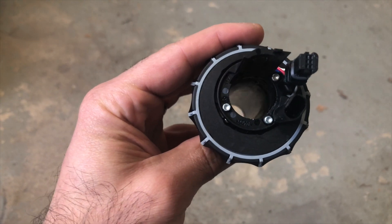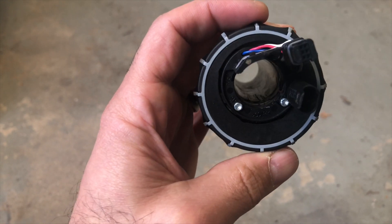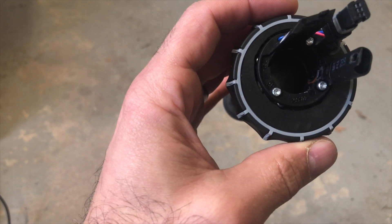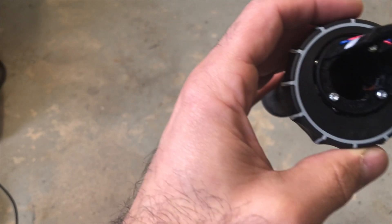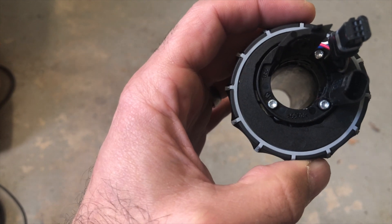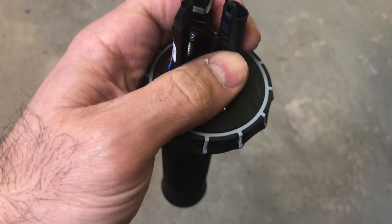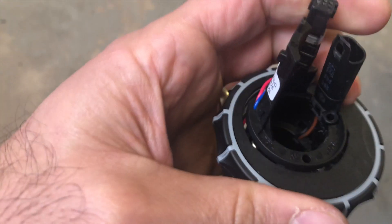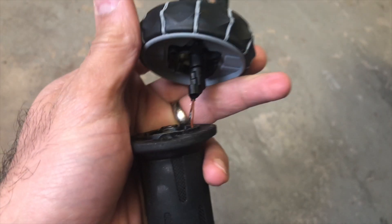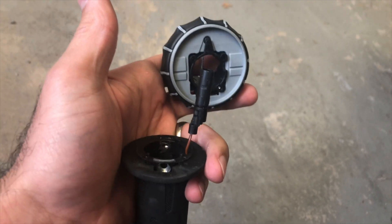We need to go further down and remove the wheel and the handlebar. We end up with just the handlebar, and it looks like there are three hex screws — TX10 as earlier. I'll remove these. The more important one is the one on the edge because the heater grip is there, so you need to push it off to separate the wheel from the handlebar.